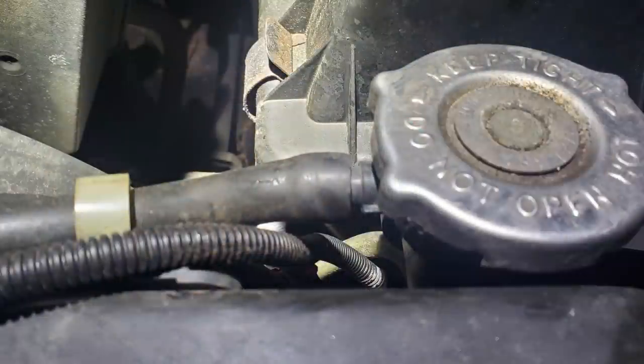Let me catch you up to speed. Last summer, my brother was driving the police model XJ home from work when he saw some smoke coming up from under the hood. He immediately pulled over and observed that the overflow line was disconnected from the neck of the radiator, causing coolant to spill out onto the radiator, creating the smoke. He's not sure how much coolant he lost or if the vehicle overheated. He got the vehicle home, but the next day the XJ did not start - it had that no spark issue.